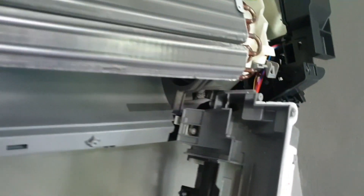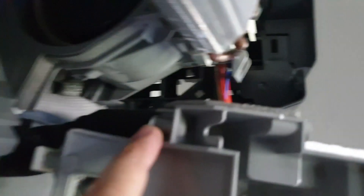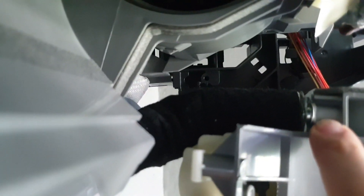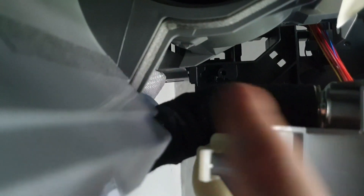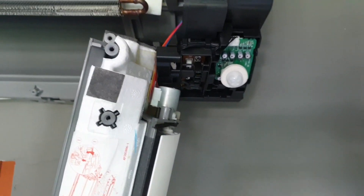So to fully remove the drain pan there are a few things we will need to do. We will need to remove both swing motors. And then there is this part here — this part has a screw here that is tightened to the drain, so if you unscrew this it will come out. To remove the swing motor I'll do it in another video if you want. But for now I think we can access the whole drain pan for cleaning. That will be manual cleaning — you can't bring it to the toilet to wash it. And you will be able to access everything here for cleaning.